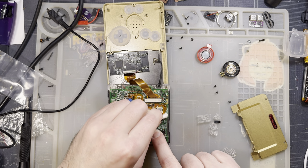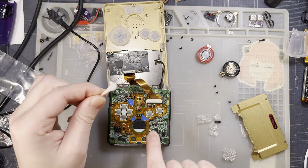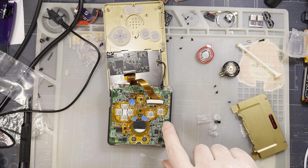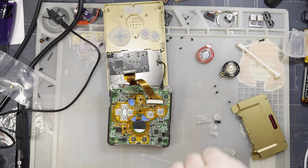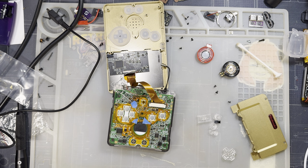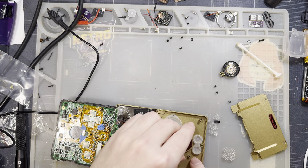Wild. Anyway, I now have a higher spec and resettable fuse in here. Unfortunately, I did not have the correct size fuse, so I kind of installed it crooked. That was intentional, because if I installed it straight, it would have been covering one of the pads. So what I did was I just scratched the solder mask above one of the vias to the left of the pad, which is contiguous with the pad itself, and then just installed it at an angle, because this is a 1206 fuse, and I believe the SP calls for a 0603 fuse, which is quite literally half the size of what I installed. So it's what I had. I don't recommend it. I will link to the proper part in the description, and maybe one day actually buy them so I have them on hand, but today is not that day.